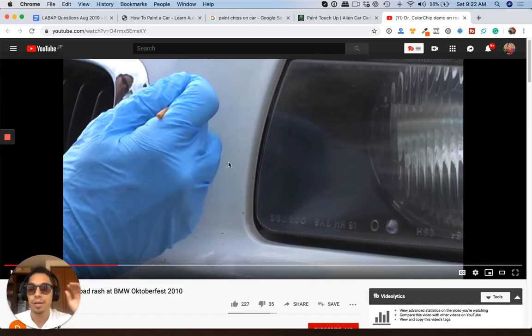Keep adding until it looks white and glossy. The more the better. It's hard because it's such little amounts, but say you have an ounce of clear coat, you would want to put at least half an ounce of white base coat directly into that. There you go, and then do it that way.